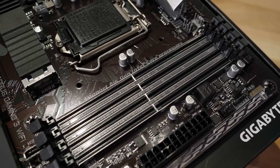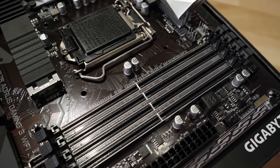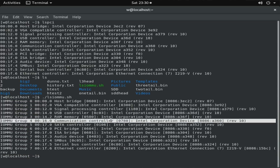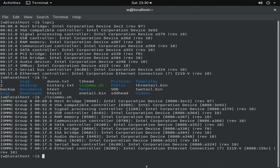It also has four DDR4 DIMM slots — something to look out for, since lower-cost boards might omit two of those slots to save a few bucks, and you'll want all four slots if you upgrade memory later. For Linux testing, this is a pretty solid board if you don't need multiple PCIe slots wired directly into the CPU. Running a video capture card with a single NVMe is totally fine. If you want to run two graphics cards, that secondary card goes through the chipset and might bottleneck when paired with high-speed NVMe peripherals. Even building a higher-end system with a non-overclocking i7, high-end NVMe, and a good graphics card would work great.